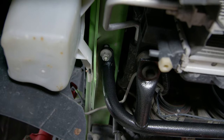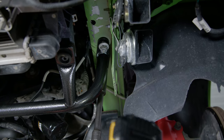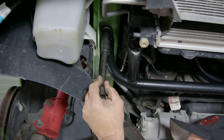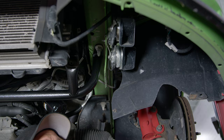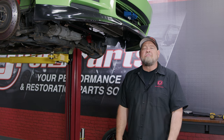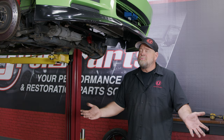We're going to snug these down and then torque them to 45 foot-pounds, and your installation is finished. The BMR radiator support is going to save some much-needed weight off the front of our Mustang, and it's going to take the existing weight and transfer it much better to the rear tire since the sway bar is now gone. Installation is pretty straightforward, should take you about an hour or so, and you'll be back on the road in no time.